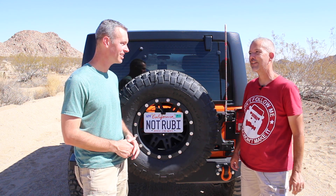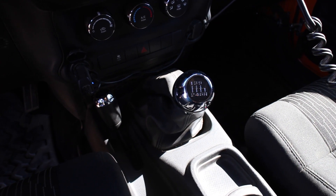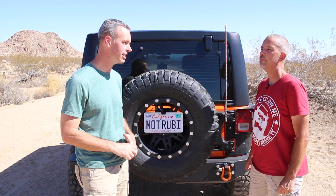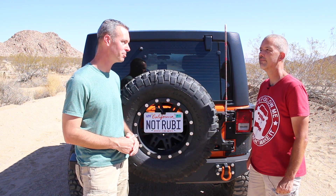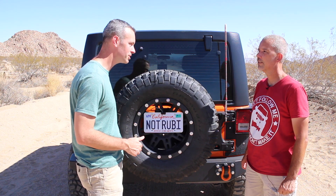It's not easy with the manual — we don't have it as easy as the automatics. You're a purist with that manual; I respect anybody that's out wheeling with the manual. Since putting the bigger tires on there, I have 4.10 gears but I know I'm going to have to go up to some bigger gears. So 4.88 might be on the to-do list.